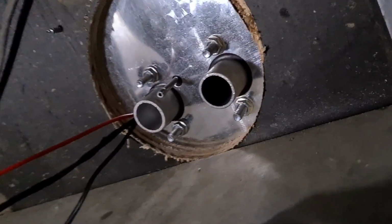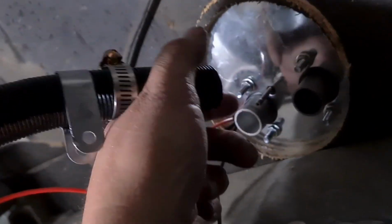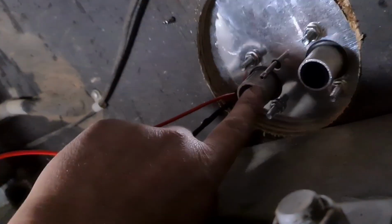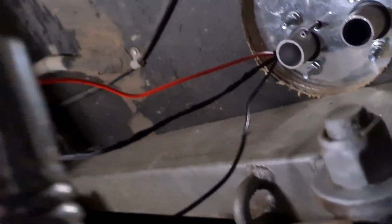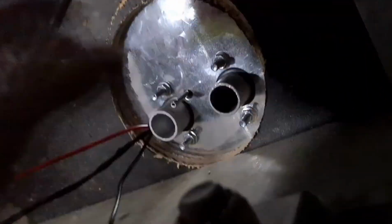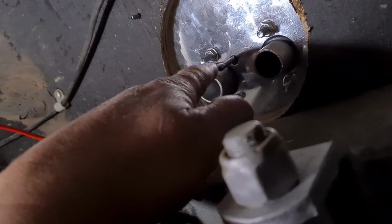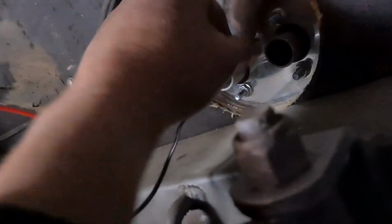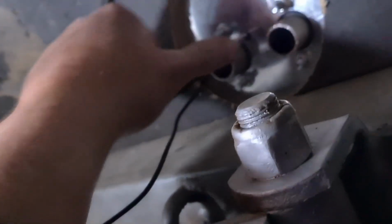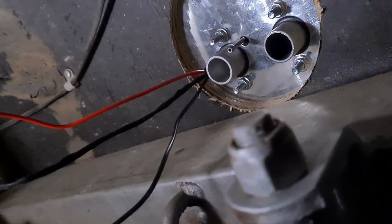And then what we're going to do is fix off our air intake to the side with the wires next to it, and we're going to fix our exhaust on to this side closest to the front of the van. I'm going to fix those off, and also this bit here, that's for your fuel line. You put that black pipe on first, and then your other pipe just goes into the black pipe and you put the clamps on. So I'll get that going.